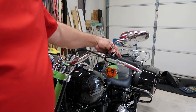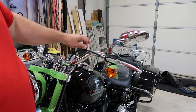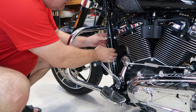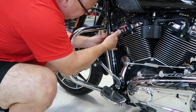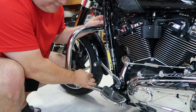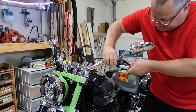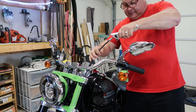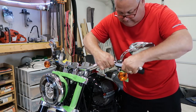We've pulled the pin out, but in order to get the pressure off here, we're going to have to go down below and loosen up the clutch cable. To take the tension off, I'm going to have to loosen and pull this up. You have to pop this clamp — easier said than done, but there it is. Now you can lift that up like that. Now that we've released the tension, we can pull this out, move the whole thing around, get it through, coming around like this, and then go back in where it came from.